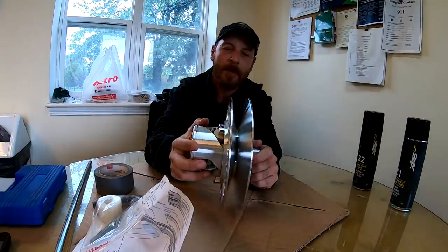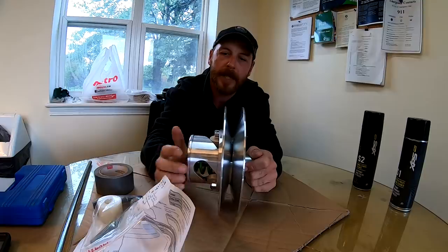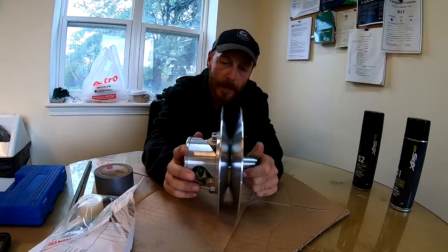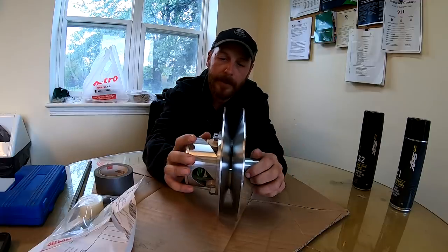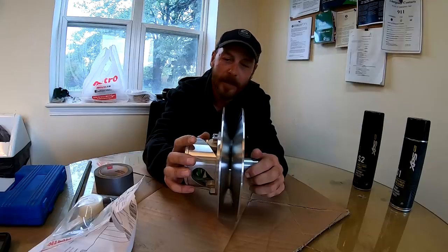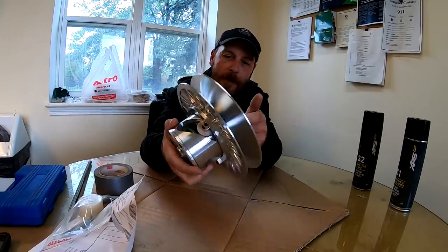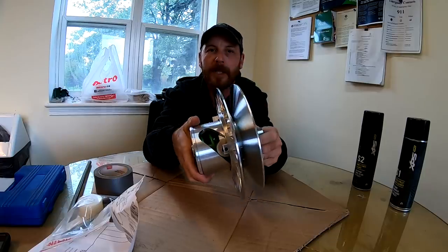What I did was I checked off five shims, not realizing that they were actually going to install them in the secondary — and they did. So we're going to have way too much slack in the belt lash. I've got to tear into the secondary. It is what it is, I messed up — not their fault. Glad to have it, looking forward to running it, and now we're going to tear it apart.